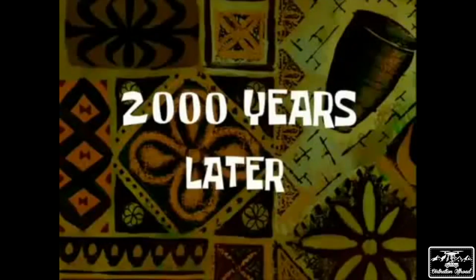2,000 years later. You guys saw earlier we replaced the fuel pressure regulator. I thought that was going to fix the running rich issue. It did not, so like I said before, we're going to start looking at O2 sensors. I know for sure that the wrong O2 sensor was hooked up, because I recalled when we pulled the motor, whoever unplugged the O2 sensor I pulled off didn't unplug it. They just ripped the wiring out. And the one that has the wiring ripped out was the front sensor, because that's the one that I pulled off of the donor motor. So I know for sure that the O2 sensor's the wrong one.